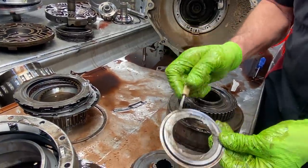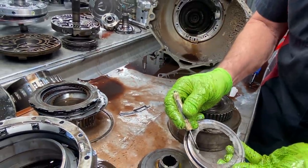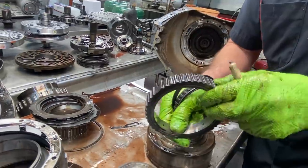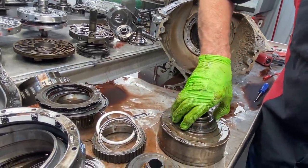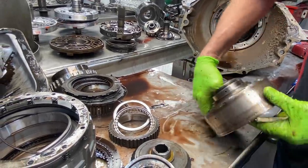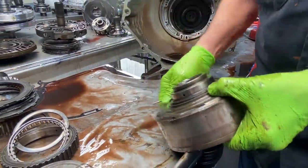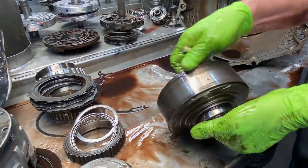Look here for any type of wear — we see a lot of wear on these two teeth right here that keeps this washer from spinning. You definitely want to look there — you don't want this washer spinning. On the outer race, you want to make sure it's not got any chatter marks. If it does, Scotch-brite it up really good, throw the sprag away and get a new one. Then you're going to Scotch-brite the inner race up and look for any chatter marks or dents from the sprag locking. Then look in here where your center support rings run — if it looks good, no wear, clean it up.